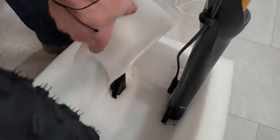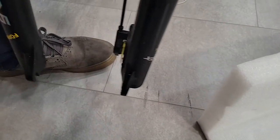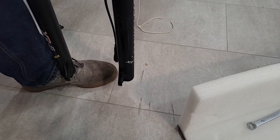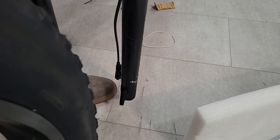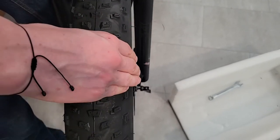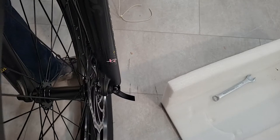Yeah, so if you look down there at that brake, I can pull this out of the foam now, I guess, but there's that little yellow spacer right here. Just gonna pull that out. That is important, and when that's out, don't mash the brake. Do not squeeze the brake, or else you'll have further issues. It forces the pads together, and it's a pain to get them undone.